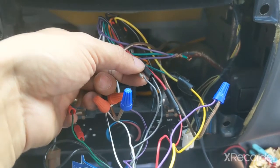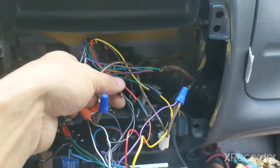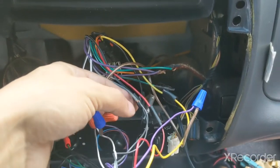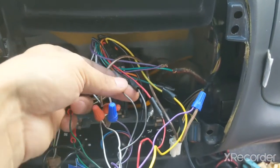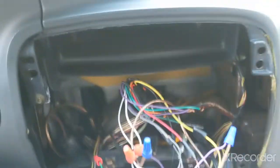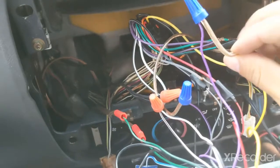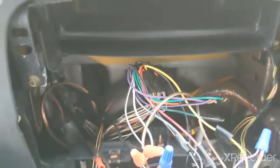In my case, the gray wires are going to be my front right speaker — that's where my tweeter is going. I'm just tying the tweeter into the main speaker. Since it's so low wattage, I don't think it's going to be an issue — it hasn't been in the week I've had the left one on. You need to know which wire is negative and which is positive. Your wire will show you — look, this one has white on it, this one does not.